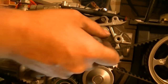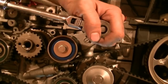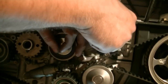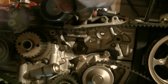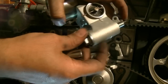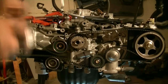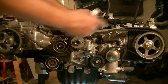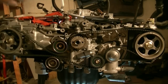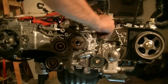Next, I take off this bolt and remove the tensioner and the timing belt. There we go — there's a washer and this piece. It's the hydraulic tensioner, so don't lose this stuff. Just go ahead and put this aside. Next we remove our timing belt, but if you're going to reuse the timing belt, just make sure you mark the direction it was rotating, which is clockwise, so you can put it back on the same way.